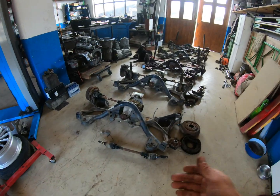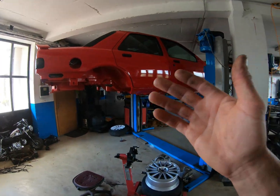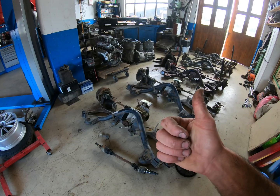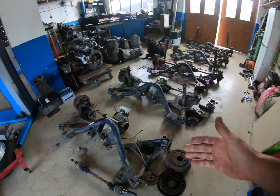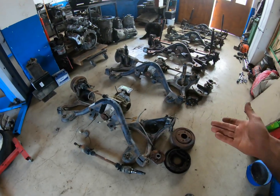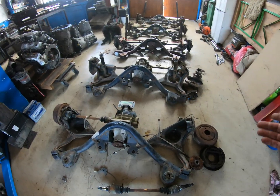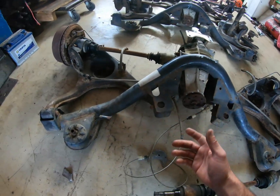The Sierras and Scorpios have much in common — many parts are interchangeable. So you might be wondering which subframes will fit your Sierra; that's what I'm exploring here. First, let's cover the similarities. The first obvious condition for a subframe fitting on your car is the mounting positions, so let's cover those. These subframes come fitted on three places — the first two places are these mounting points here.